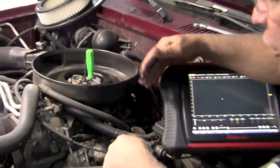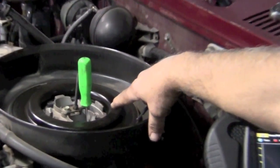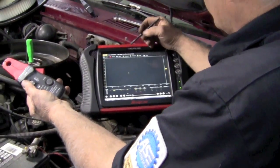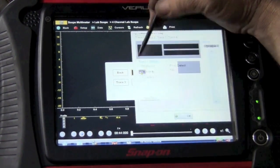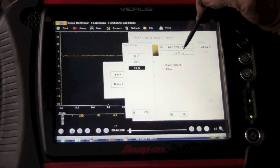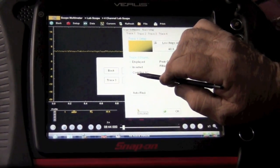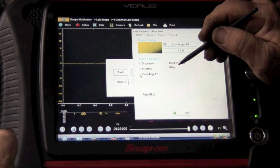In a compression check, in addition to making sure there's no obstruction to air, you also need to make sure the car won't start — you want to disable the ignition. You want it to crank, but not start. We'll go over to the lab scope and set this up. I'm going to be on trace number one, set it up for 40 amps — that's the most mine will show. You actually need to do AC coupling if you're going to be doing a relative compression check.